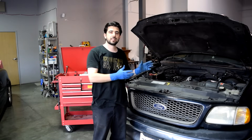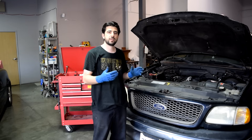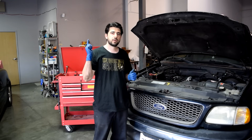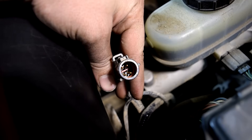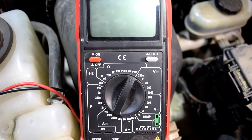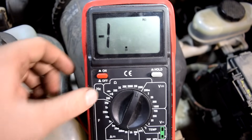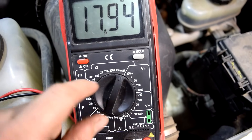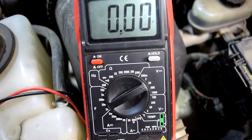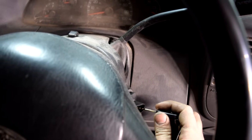If you want to see me actually test the mass airflow sensor using a multimeter, here are cuts from a video I did about a year and a half ago. So as you can see, we've got four pins on this wiring harness. The first thing we want to do is find our constant voltage supply from our ECU. Get your multimeter, turn it on, and turn the settings to 20 volts, since we don't expect to see anything more than 12 volts when testing for voltage. Grab your black test lead, get in your car, put the key in the ignition, and turn the ignition to the on position without turning on the engine.